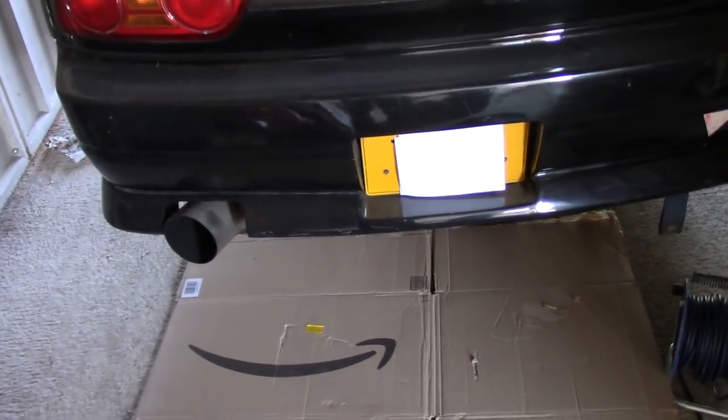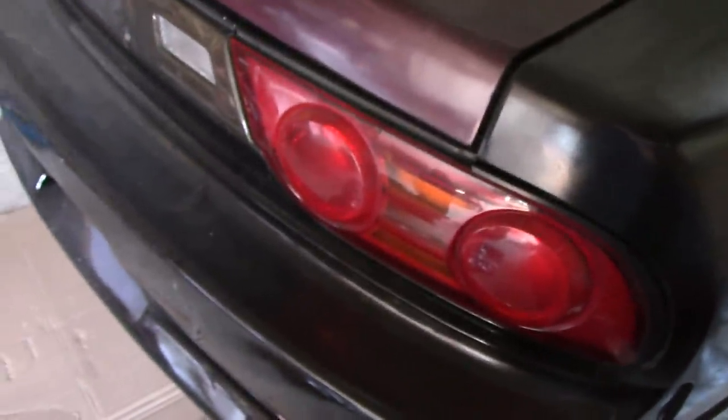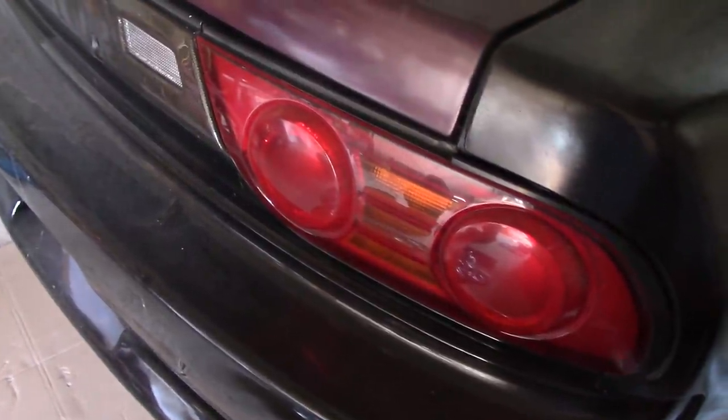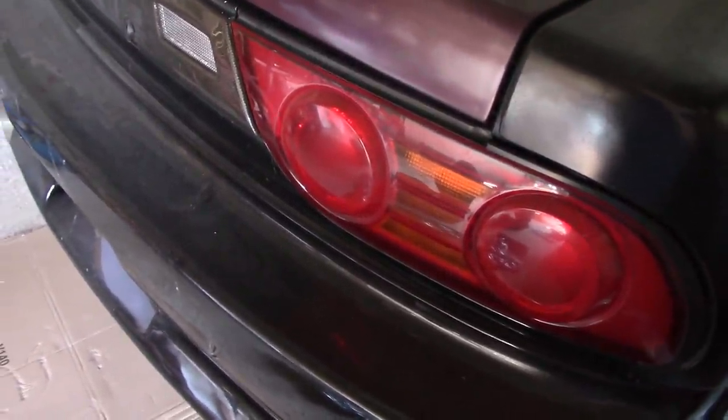We're going to crack on with the Nissan. Today it's going to be an interesting one. I haven't done this before. We're going to do the rear end restoration underneath, from there, a little bit further, maybe about there, to there. Now on this car, that's where the gas tank is. So the first thing is, let's drain out the gas tank into a container over there if we can, and then remove the gas tank, then inspection, and we'll take it from there.